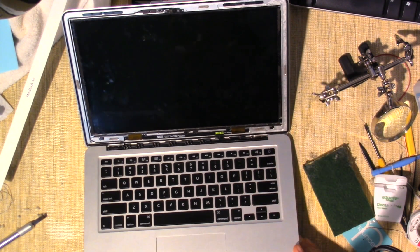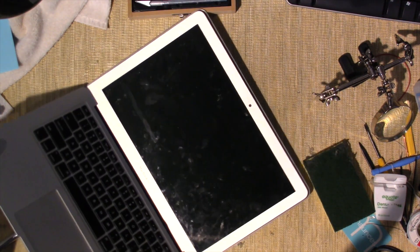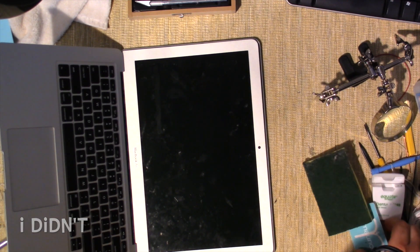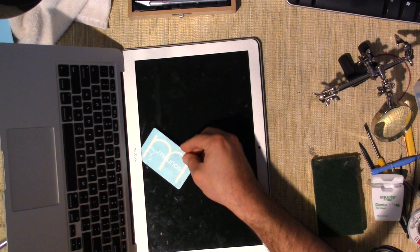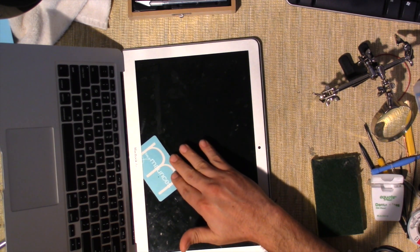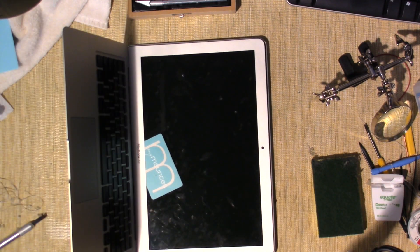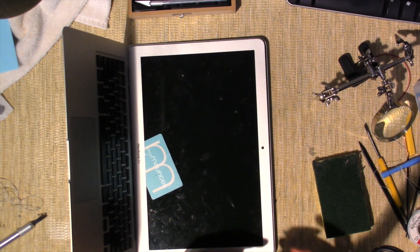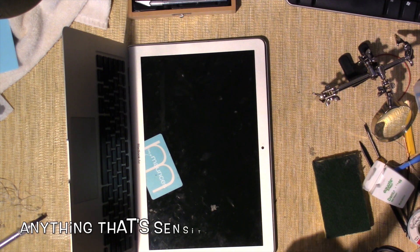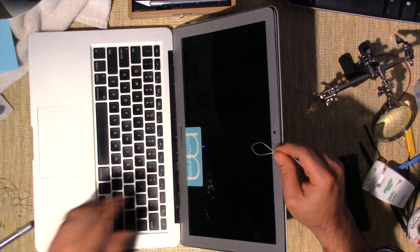I just wanted to share how I got the bezel off. The bezel was on like this, and I laid it flat, being really careful not to bend it. I took a gift card, wedged it nice and easy right where the MacBook symbol is, enough that it was peaking out to the side. Then I took regular dental floss — doubled it up and slipped it through underneath the gift card. I would just scissor it from there, though it does break from time to time.